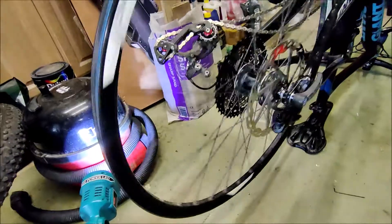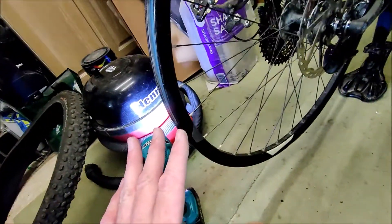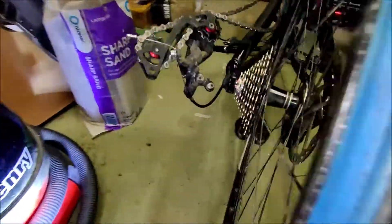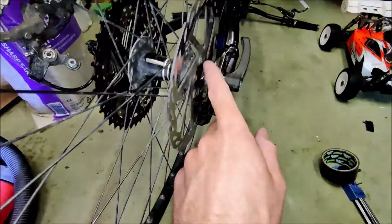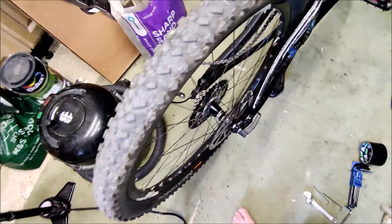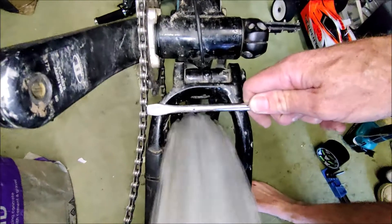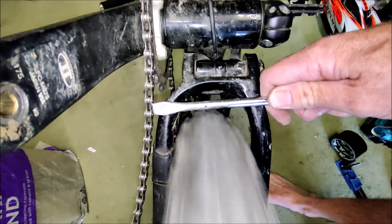There really isn't much wrong with that rim, so I think the best move is to get the tire back on, seat it on the rim nicely, and see whether it was all down to the axle adapters. Tires back on, rim is in the bike — let's spin that wheel up and put the screwdriver across. Look at that — we're still getting the same range of movement.